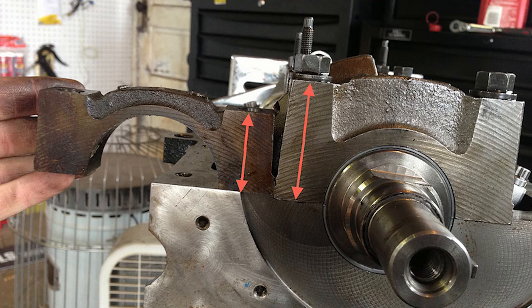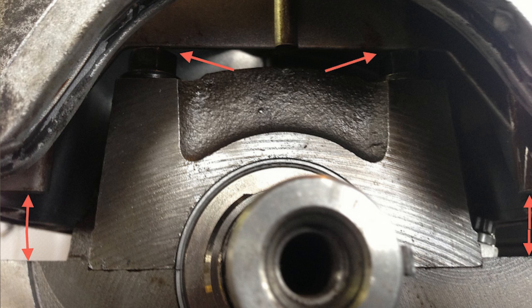The main bearing caps on the Contour engines are bigger than the main bearing caps on the ZX2 engines, and I have to put the ZX2 windage tray onto the Contour engine block in order for it to fit up to the transmission. So that means I have to grind away at the windage tray in order to clear the main bearing caps from the Contour engine.